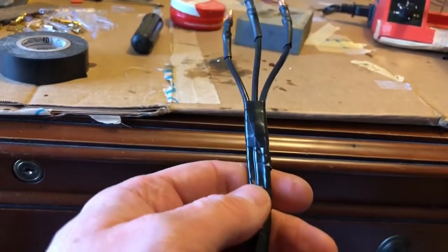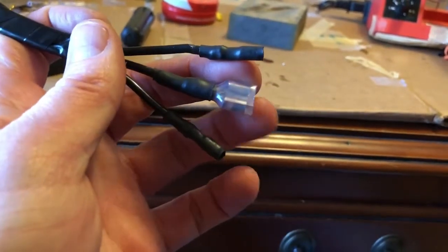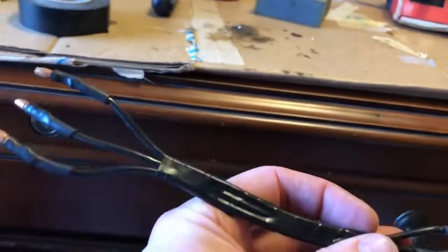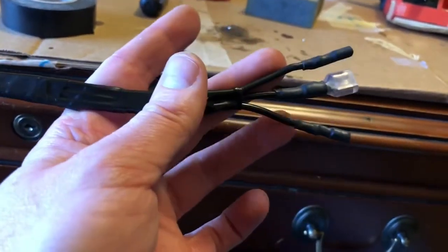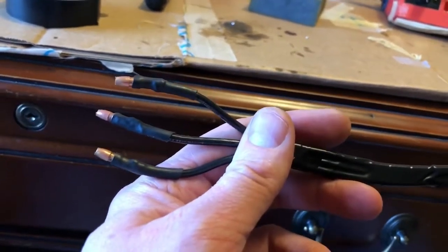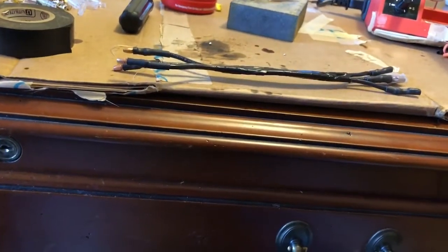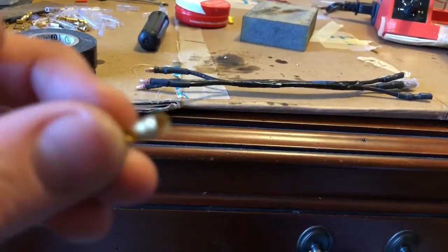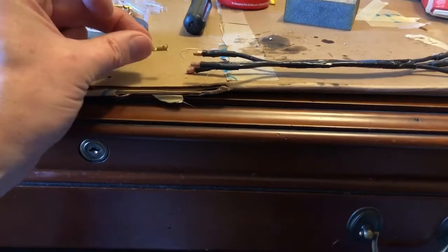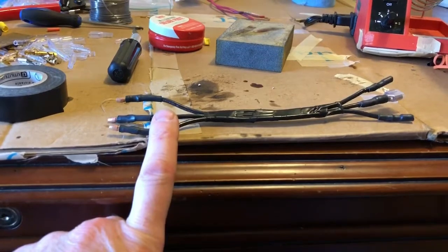I made a makeshift loom using utility tape — there's also a paper-cloth type you can use. My two turn signals share a ground going into a twofer. I only had black wire, so they're all black, but one is green and the other is dark brown depending on whether it's the left or right rear turn signal. I'm going to end up cutting off that connector and soldering a female end on the three wires.